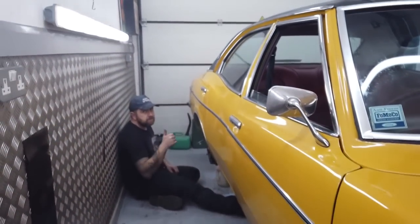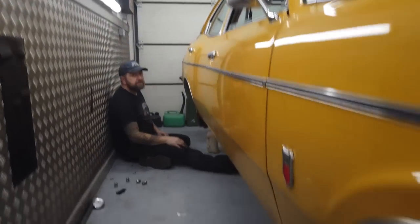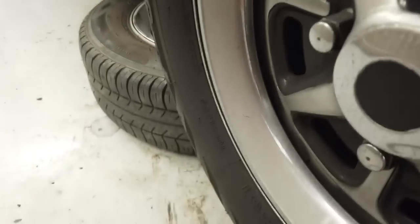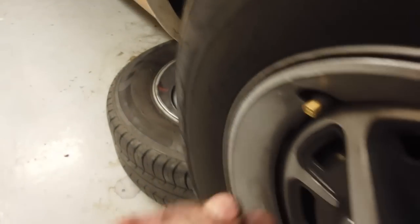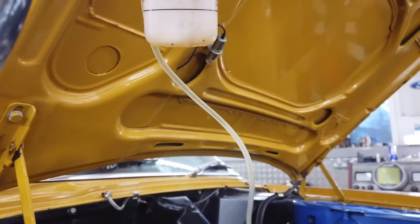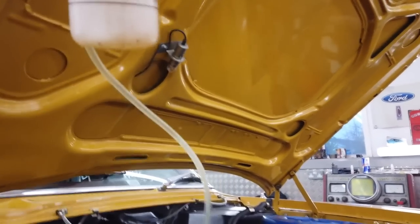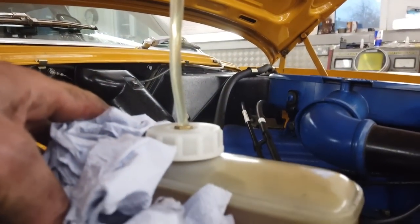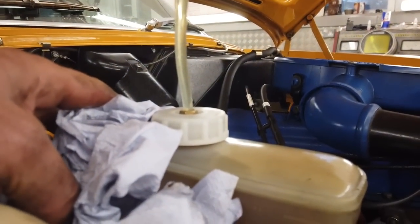That man over there handles an 11mm bolt when I pressure up. You ready for me to pressure up, Mr. Richard? Ready when you are. So I pressure up here. As I do it, it's a little tip for you. Put it on, and then watch your reservoir and make sure it doesn't seep out. Now I'm watching that carefully, and I've got this cloth ready. I seem to be good to go.